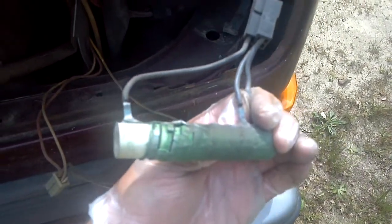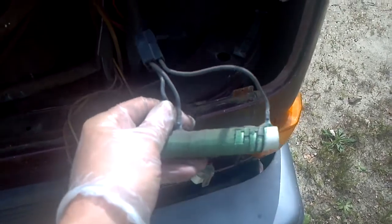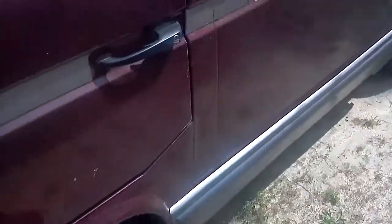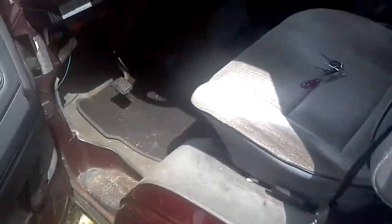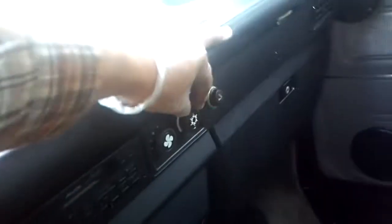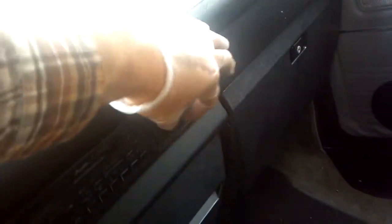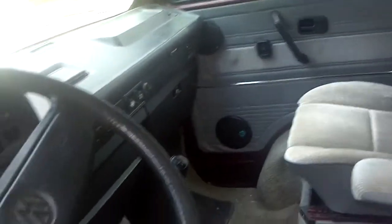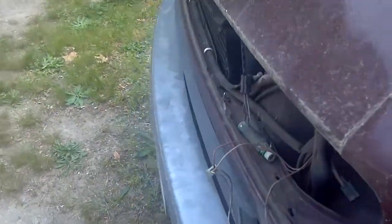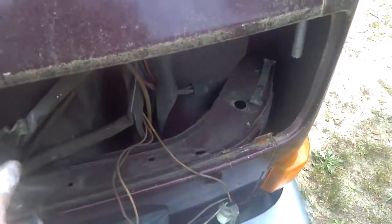The green on the outside is going bad. An easy way to tell if one of these is bad: come into the van, turn on your AC with the key on. When you turn on your AC — some of the earlier ones have it up in the roof — turn on your fan speeds. If you can hear the blower in the back coming on and the compressor is coming on, but there is no radiator fan coming on in the front as soon as you turn that on, usually that means this resistor is bad.